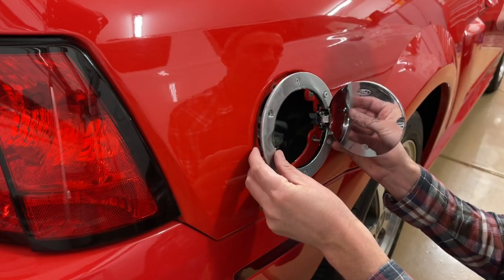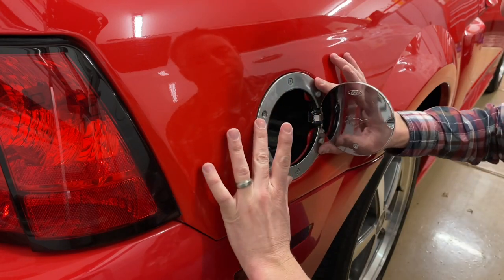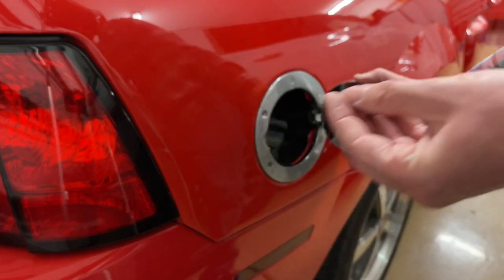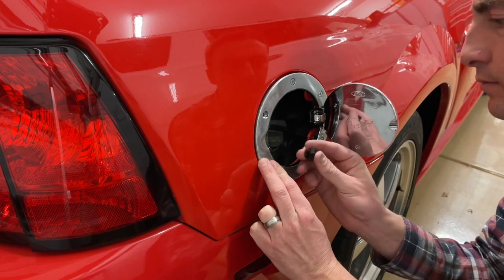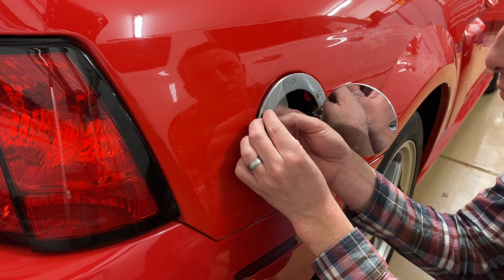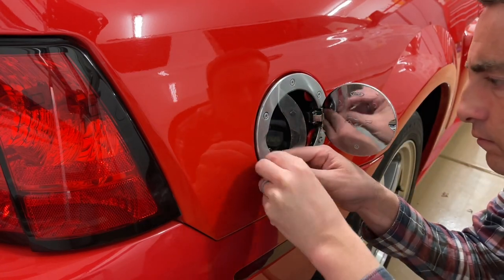There are two other screws and we just leave them as they are, already attached. You could remove one of those little nuts on the back of the others and take them to a hardware store, or just take the whole thing in. We're going to go ahead and put the little rubber piece on the inside — basically installing it back. Here it is on the top and the bottom, and it's barely holding on that way. You will need to get some hardware from the hardware store. Now we just put our black clips in here, sliding them in so they're pinching over that body trim little ring area, and put the screws back in — very easy to do.